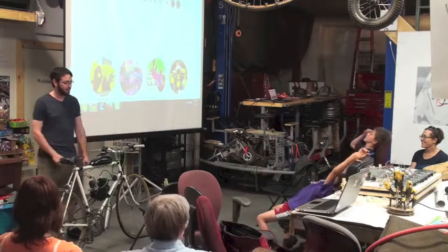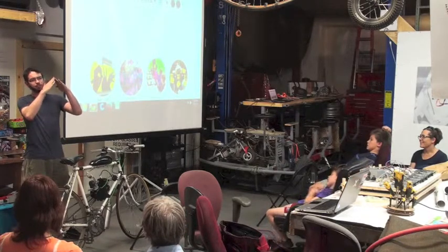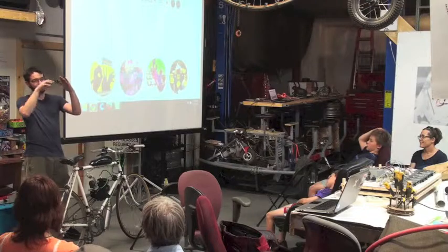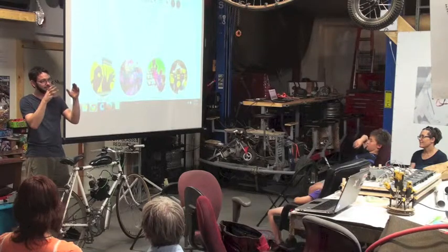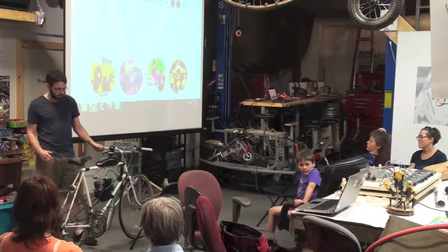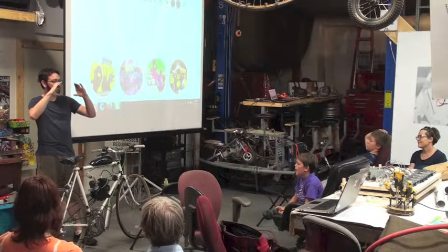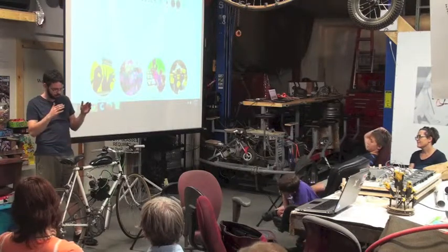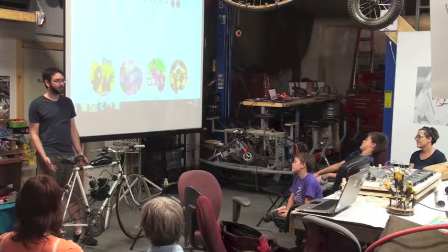Yeah, the smart board. So Flowmaster does this really cool thing on the inside of their mufflers where they have triangular baffles. So as the exhaust is flowing past them, it creates a negative pressure zone, which basically, in theory, sucks back sound towards it and then cancels it out. So that's my next project. All the Flowmasters that I've seen are the oval mufflers that you have about this big, and all the baffles are flat. So in this, I was going to try to make cones that went through the center. See how well that works.